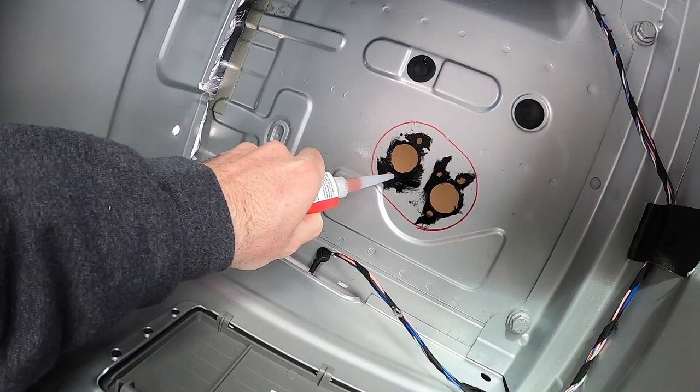It's not long enough to reach all the way across, and I'm not really trying to mess with the combustion since you can only have this no more than two meters. Here is the intake hose as well, with a crimp to secure it on — everything is really tight, can't pull anything off. Now I'm securing the muffler down using the T30 Torx, screwing a pilot hole into the frame, and bolting the bracket and muffler into place.